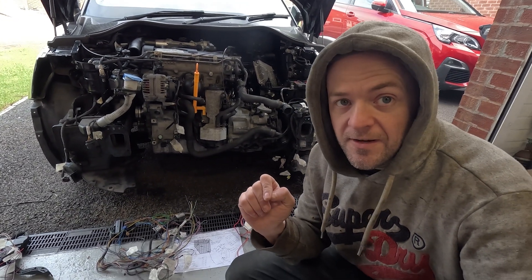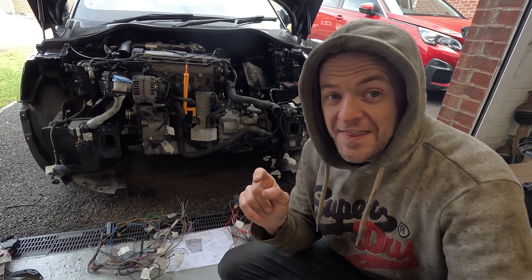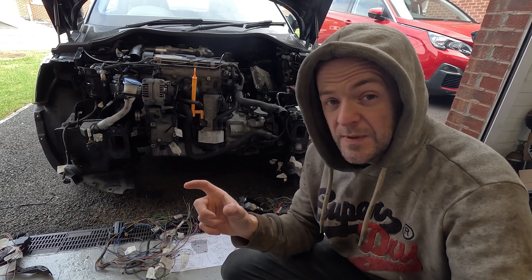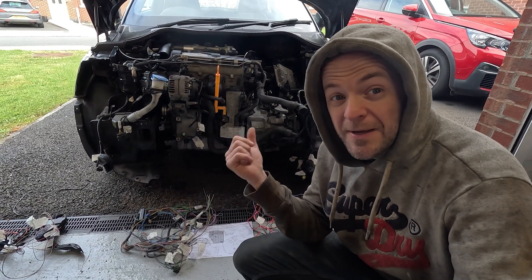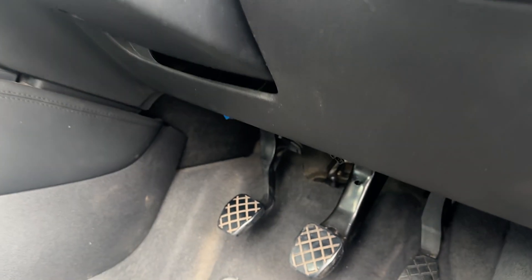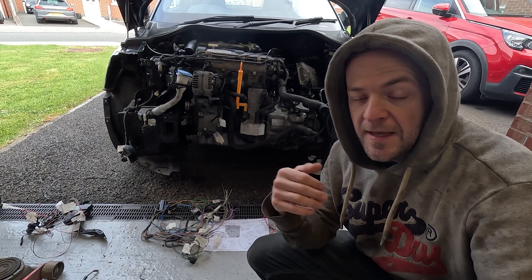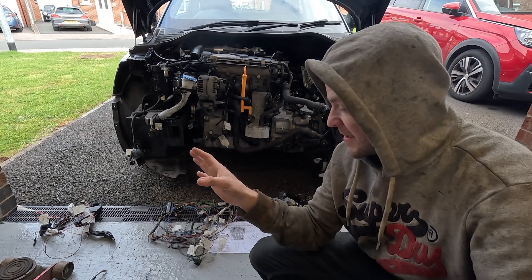The reason I've realised, looking at the wiring diagrams, is that the clutch and brake switch on the A1 is actually on the master cylinder and not the pedals themselves. I think I need separate clutch and brake switches because I'm leaving the A1 ECU in — I think that will work the ABS — and I don't want to chop into those switches, or cause confusion between the two ECUs. I need to put the Fabia VRS ones back on the pedals, but annoyingly the pedal box doesn't have any facilities for that, so I'll have to make a bracket. As long as it starts and runs, I know this is working. The clutch switch not detecting the clutch could hang revs between gear changes, so I will need to make a bracket at some point.